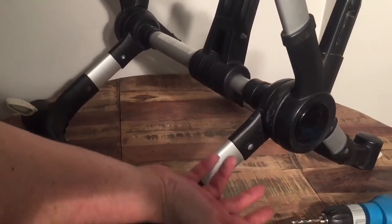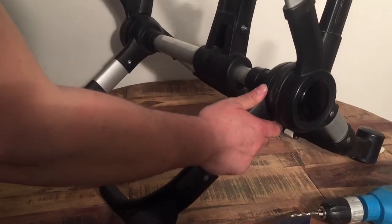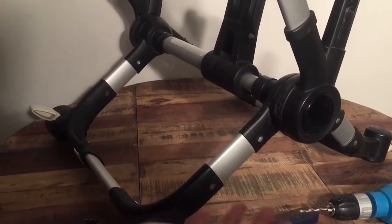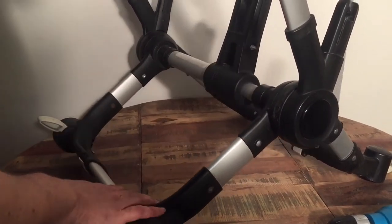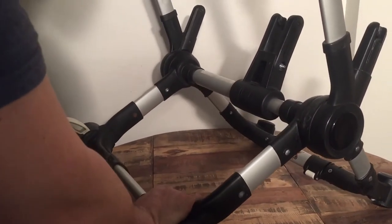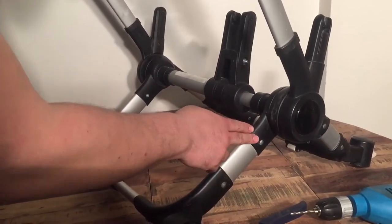The customer wants to save a little bit of money, and the damage is most likely not that much. So we're going to do what we can to tighten it in other ways. If these were so damaged they would need to be swapped, you would notice that you could push down completely on one side and you would only get resistance from the undamaged side — and it hasn't gotten to that point yet.